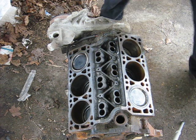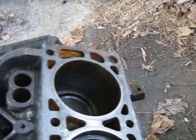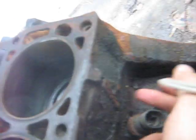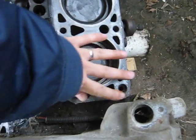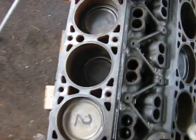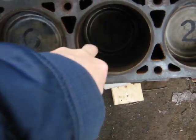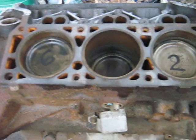What I would do to actually build it: you'd spin her over with the pistons at the bottom, cut ports in there, and exhaust out through the water jacket — basically the water jacket would be empty. One whole block of three pistons on each side would all be exhaust, and the other side would be intake. A person could do the same thing on the intake side — drill holes through the cylinder wall and use the water jacket on that side as an intake manifold.